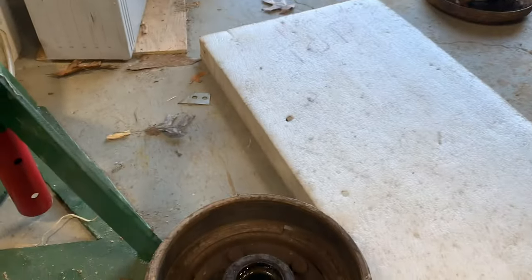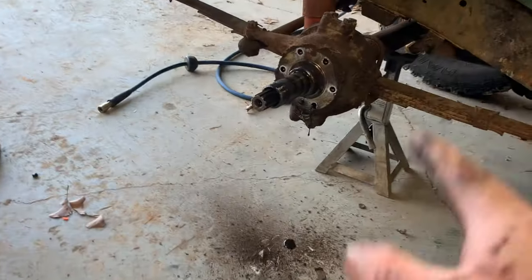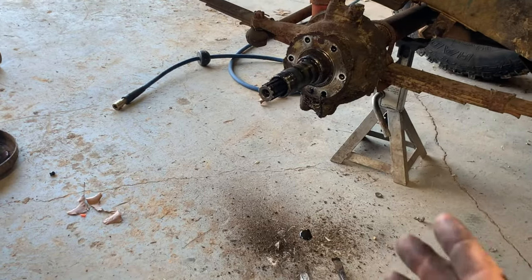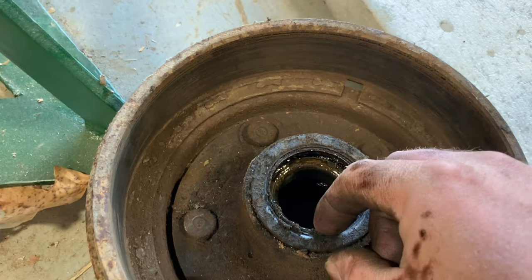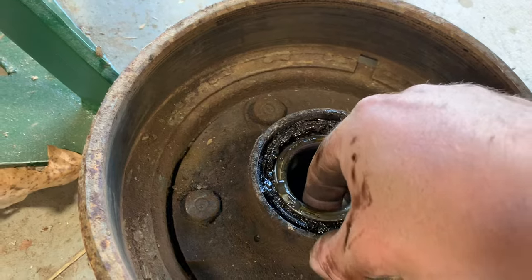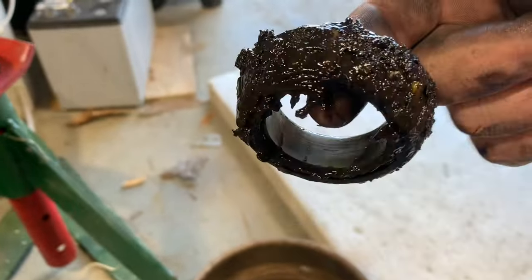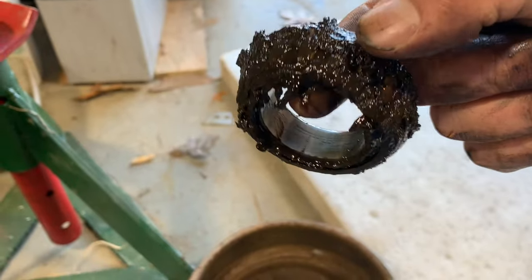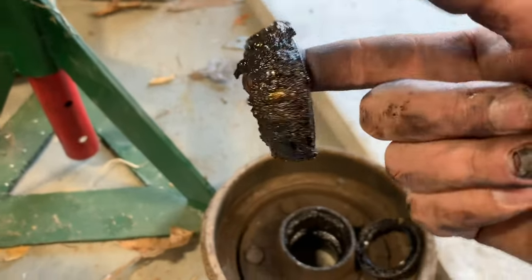So hopefully I can give you all a leg up on everything you're going to need to order and think about to do this conversion. Now, hopefully your Jeep's in better shape than this one is. This one obviously hasn't been fooled with in a long time, since like the 90s. I should have thought to order some new hub seals right here. I got this one popped off. And look down in here. I don't think you want your wheel bearings to look that way. That is pretty bad. Hopefully, though, it'll clean up and be all right. I might be needing some new wheel bearings, too.